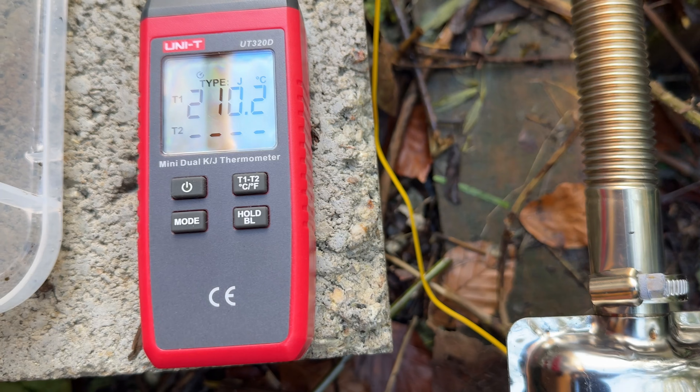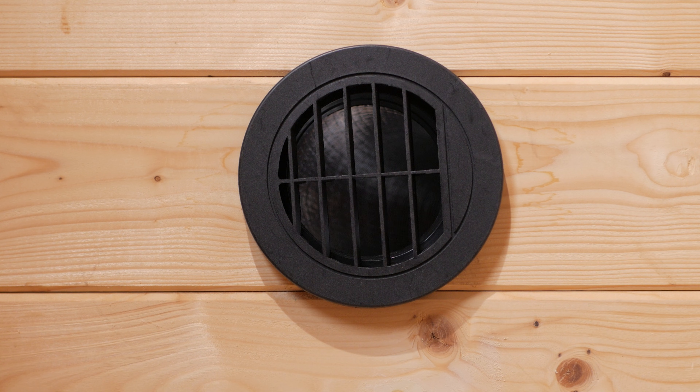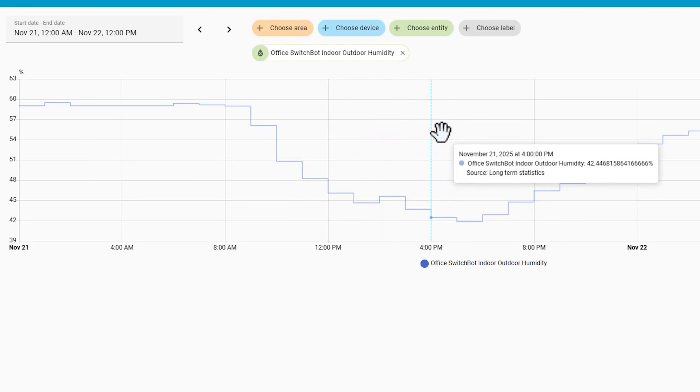Additionally, the exhaust can get very hot — I measured the exhaust pipe with my temperature probe at over 200°C, so make sure no children or animals can come into contact with it and ensure it's kept away from anything combustible. I was concerned I'd smell the diesel heater, but that hasn't been the case; there's no notable diesel smell in normal use. The only time I noticed anything was from my permanent install through plastic vents — there was a slight smell from the plastic when it first heated up, which disappeared after a short break-in period. Diesel heaters do dry the air very effectively; I saw humidity drop to around 45% at times, and at that level I found it really dried my eyes.